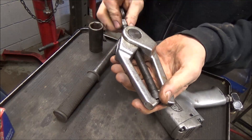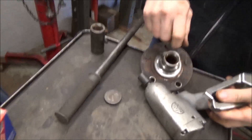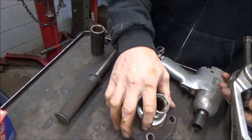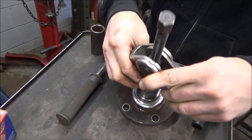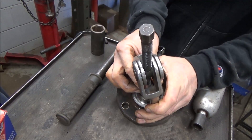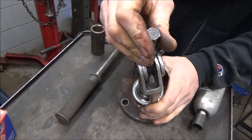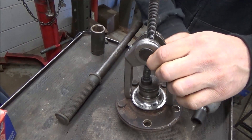So we're going to use this little puller here. She's seen better days — the end of it's falling off — but this should do the job for us, hopefully. But this big flange is on here, that's actually part of the seal. So we might have to rip that off first and then get a hold of the race. We'll see. Sometimes that seal can be pretty resilient and actually pull the race off. So I'll kind of get this started here — it basically just grabs a hold of it like that. But like I said, don't be surprised if it just rips the little seal off first.